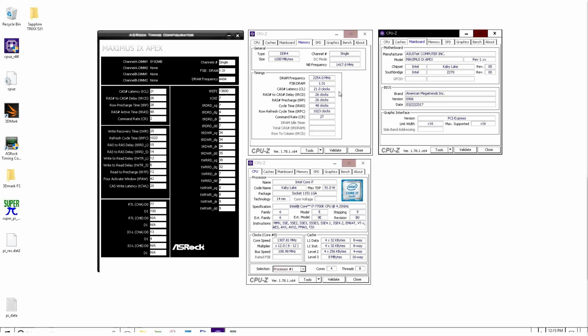The big problem with running really, really high memory clock is that it generally ends up hammering the CPU's memory controller. It's not a problem of the memory kit or the motherboard or anything like that. I'm pretty much sure I hit the limit of the CPU. So if I want to go beyond the speed you see here, I do believe I'll have to put the CPU on liquid nitrogen, because as it is on the little AIO cooler, it just doesn't go any faster than this.